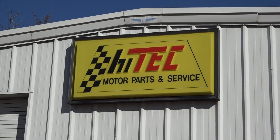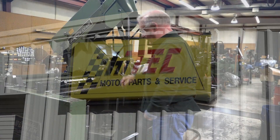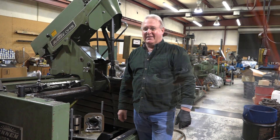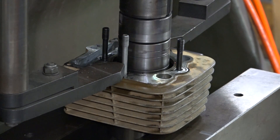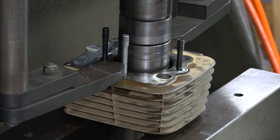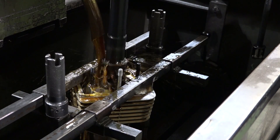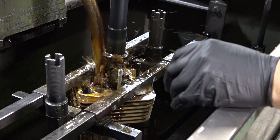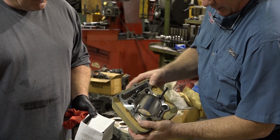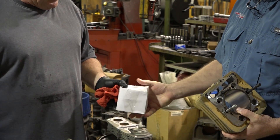You definitely want to find a good machine shop to do your work. I use Hi-Tech — Tim Crimmins — and he's been doing this for 30 plus years; he is definitely the man. What he's doing now is just boring the cylinder first, and we're only going one size over so not taking a lot of material. Next he put it in the honing machine which actually cross-hatches everything. And now it's complete — really looks good in there, nice smooth bore. Let's head back to the shop with our piston and get it put back together.